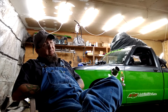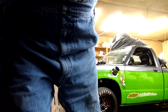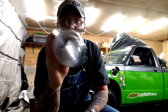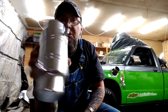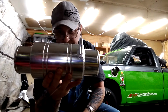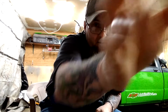It's got a 2.5 gallon ice box, run through a little 30-row plate and fin cooler with a 9-inch fan on it, through the little cryo coolers, which I'll show you one of them if I can get it here without knocking a bunch of crap over. I've showed you guys these before. It's a little, what they call cryo cooler, 3-inch in and out, -4 in and out, and it's got a coil that runs all around this, and you can pump CO2, whatever you want through them to cool your charge air. I'm just going to use like water and ice. Probably on the street I won't run nothing in them, but if I ever race I can put ice water in it, dry ice and water, whatever. It don't matter. Just set that up there.